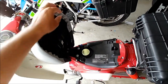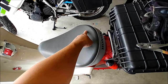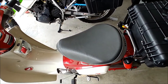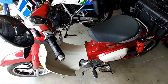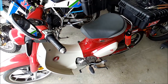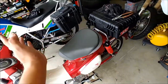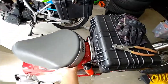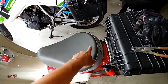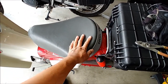To prevent that from happening, slowly lower it, wiggle it a little bit so that little fin goes into the slot, and then it's easy — just pressing it down with one finger. So there's a little tip if you're having trouble closing the seat or the gas tank cover on your Honda Super Cub C125. That could be the problem — your fin might be bent. I've just been slamming it down, so from now on I'm going to close it slowly and feel for the latch, because sometimes it's hard to get the latch back on properly.